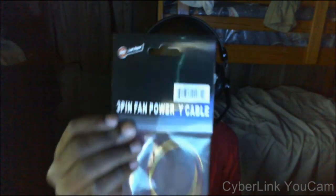This is a splitter cable for the fan because I only have two slots on my motherboard for fans — the two slots go to the front fan and the back fan. I know I'm only replacing the front fan with this, so I don't need a splitter right now, but when I get my CPU cooler it's going to have a fan on it. The CPU fan slot on the motherboard is currently taken by the front fan, so I had to get a splitter.